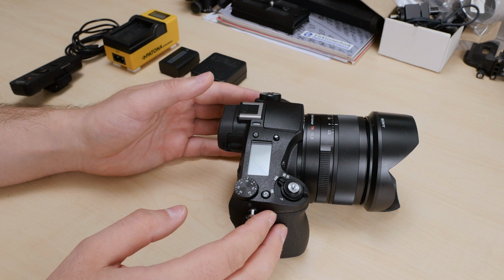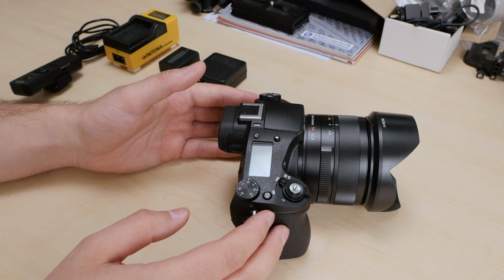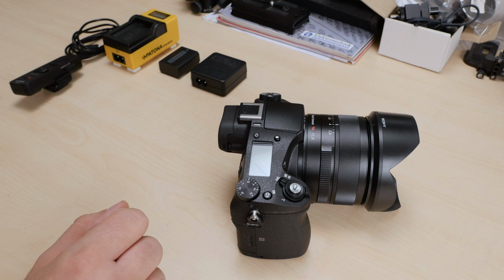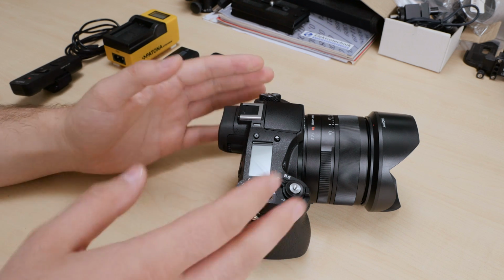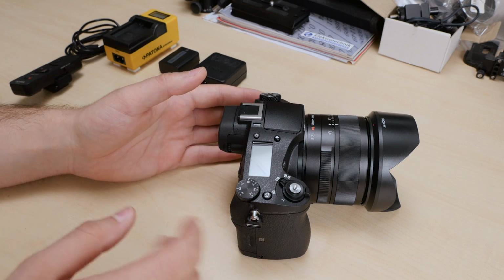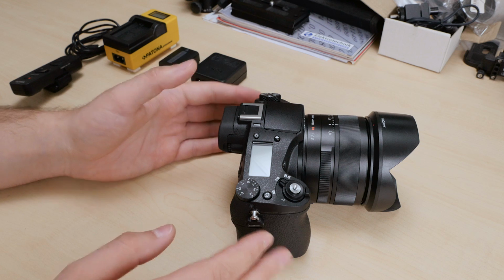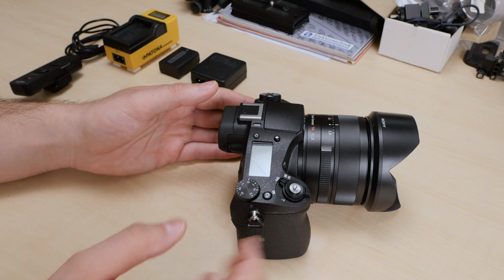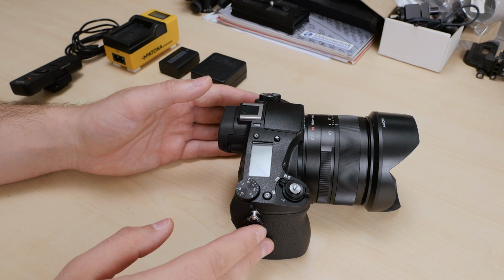But if you need 2 second or 4 second in time priority mode, high frame rate shots for special purposes, go for this camera. By the way, the limitations are you only get 2 seconds with higher picture quality, or as mentioned already, 4 seconds with time priority setting, but you're losing quality. And for 480 FPS, for example, it's looking like 960 FPS in 2 seconds mode if you choose a time priority. So I recommend to use quality priority most of the time.